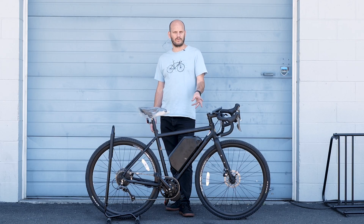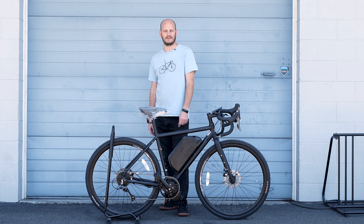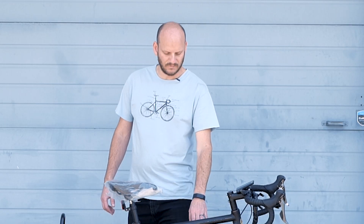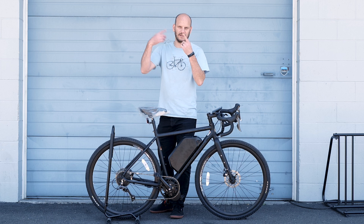You can see 34 miles per hour, and this was on a half-charged battery at 51 volts. Fully charged, this is 58 volts, so I'd probably get about another two miles per hour out of it on a full charge. We like to store and ship batteries at half charge. This bike is going to a customer who shipped it to us, and now we're shipping it back to them.